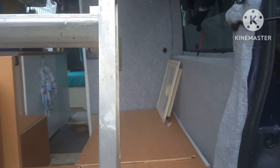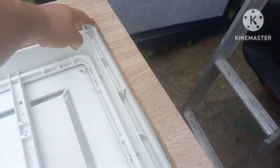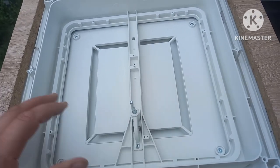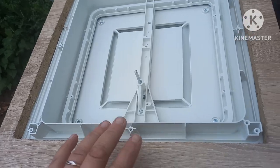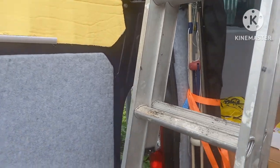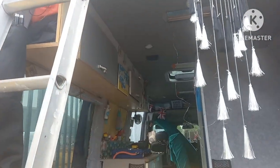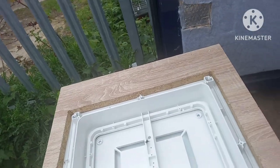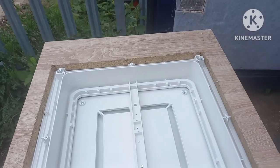I do have a jig I made for skylights. This is the jig — a piece of wood which is 400 by 400, so I've fitted quite a few of these skylights now. You need a little bit of wiggle room; you don't want them too tight. Basically that will be placed inside and cut out first, then I'll drill four holes in the four corners through the roof through the metal, and that'll give me my lines at the top where to cut. I'll mark them up with a rule and a pencil or black marker and then cut them out with the jigsaw or the grinder.